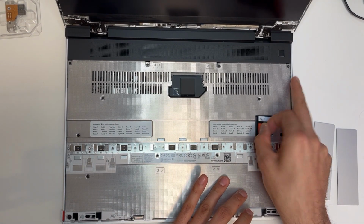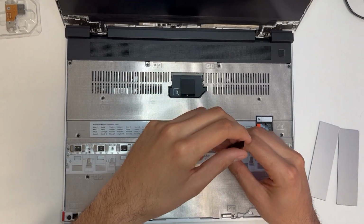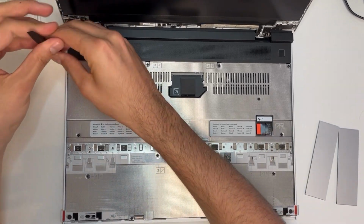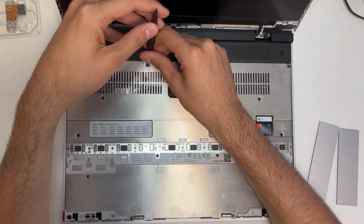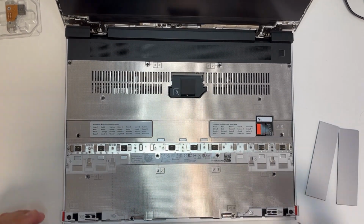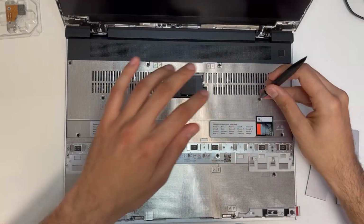Next, you have to remove the mid-plate connector, so how that connects to the motherboard, I want to say, from the mid-plate. And then you have to unscrew a bunch of screws. There's 16 screws, and so fast forwarding through that took me a little while. What's nice about these screws is that they're magnetized, so you don't lose them, you just have to loosen them. So love that. And then you can just kind of take off the mid-plate when you're done.